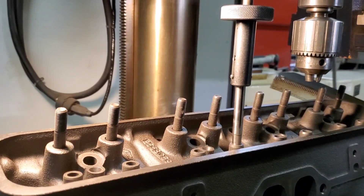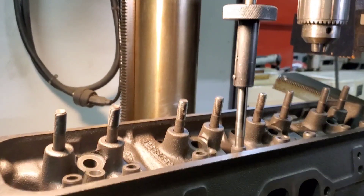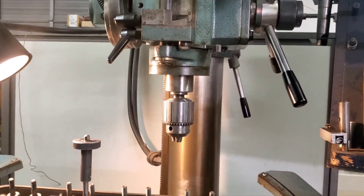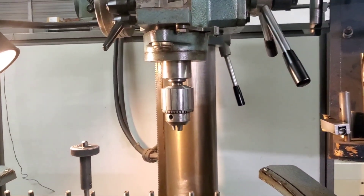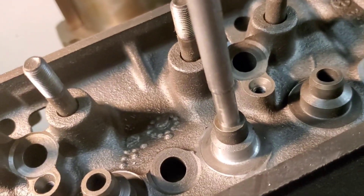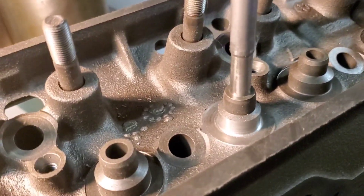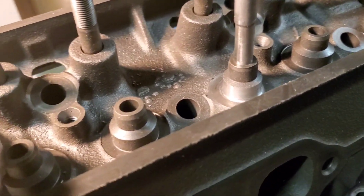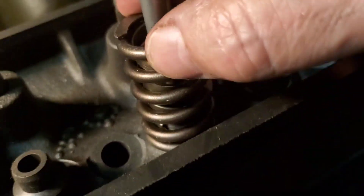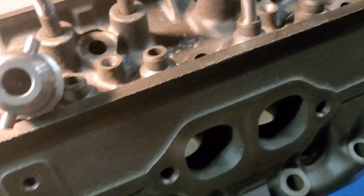We'll move our head up on the column to give us some more room to the table. I got back and you can see I've cut that inner edge down. Got our Z28 spring — fits on there just like a regular stock small block Chevrolet. You can kind of see how much we've taken off there.